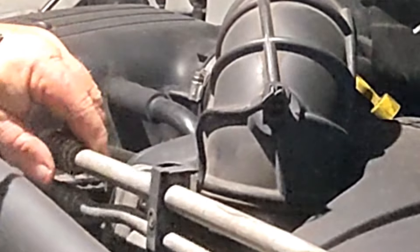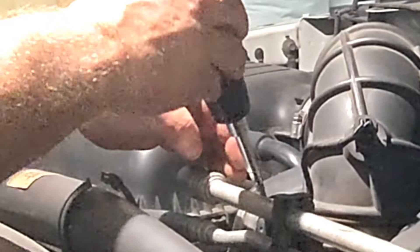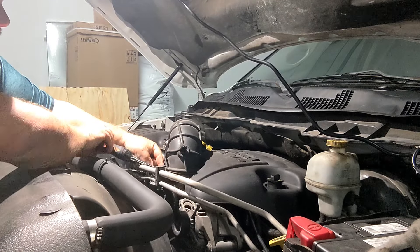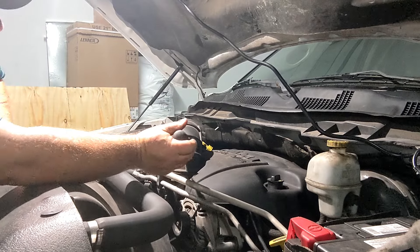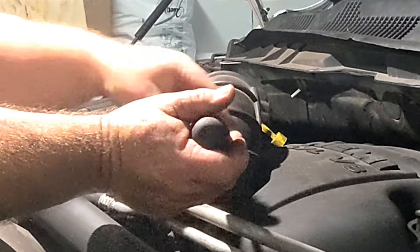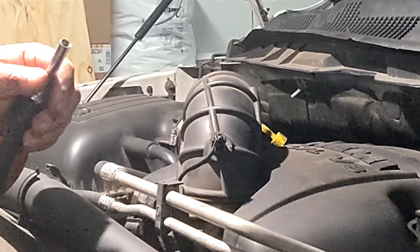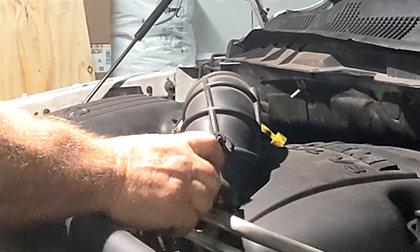This is an intake hose — we're going to take that off. We're going to disconnect the wiring harness on the throttle valve. There's a red locking pin; you slide that all the way back, then get a little screwdriver and stick it in there and give it a little twist. Everywhere I go there's hose in the way. We've got a clamp back here — on some of these 6-in-1 screwdrivers they've got two nut driver sizes, 5/16ths or 8-millimeter, and one is 1/4-inch. Usually the 8-millimeter fits these hose clamps.